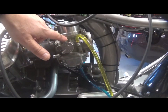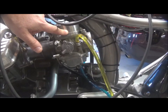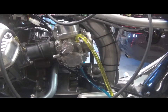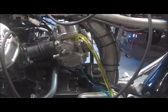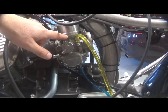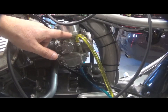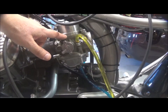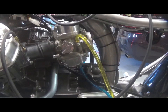On both the right and left carburetors, after I finished cleaning them and put them back together — all nice and polished — I painted them with this penetrating primer oil, which is really nice stuff because it keeps them shiny. However, some of that oil must have snuck in between the joint of the top cover and the body. This stuff actually dries up like a varnish and it caused the piston to get stuck, so the piston wasn't moving.